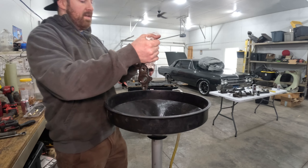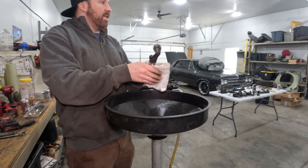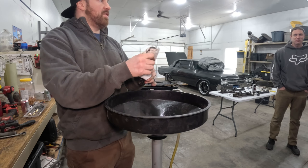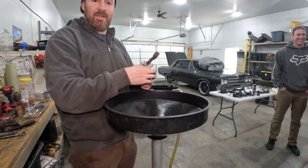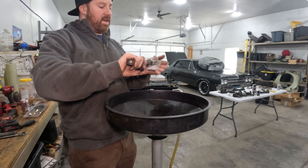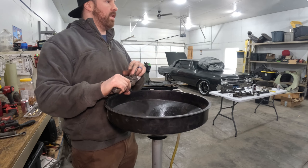Look at the rear - there's still backing plate in there, that's not gone. It'll make noise, but you won't be able to hear it - this thing is going to be making so much horsepower. Just plug them off. 70% of the braking is done in the front, so why not just make it an even hundred?